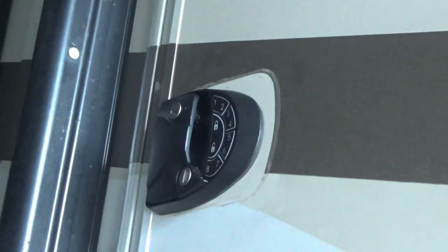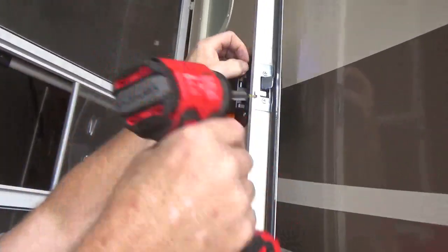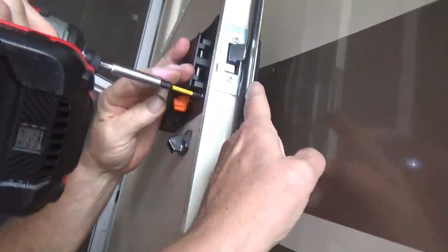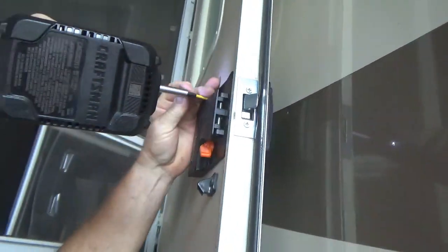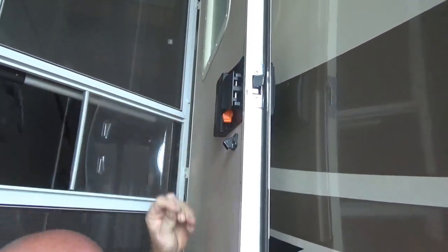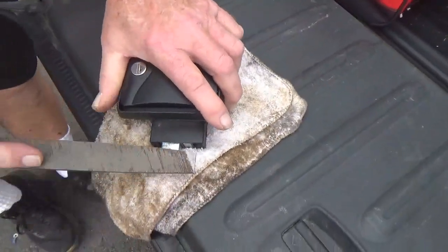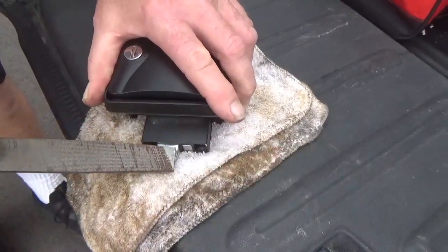So what are you going to do? I got to take the lock out and grind away a little bit of this latch on the back side of it - on the flat side of that latch. Because the rubber seals in the door are too thick and I think it just makes it a little too hard to open and close. So since we have that big fat seal on there, you're going to file off a little bit of the back side of this latch.